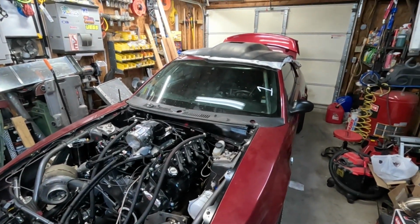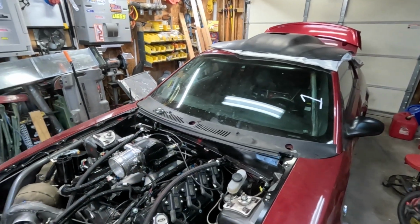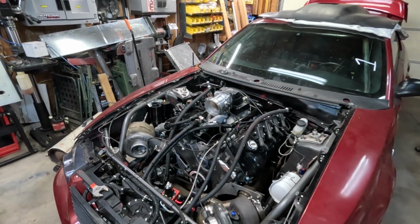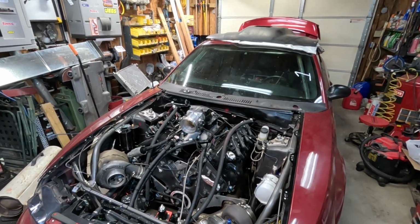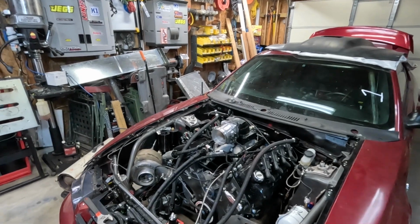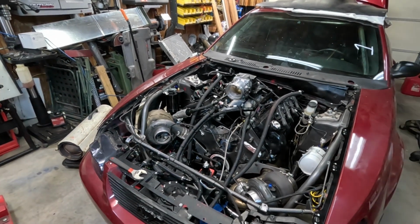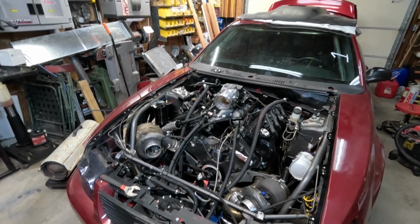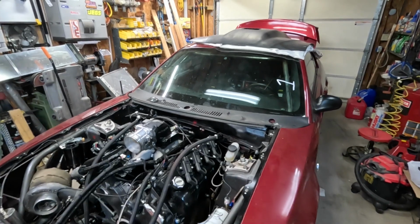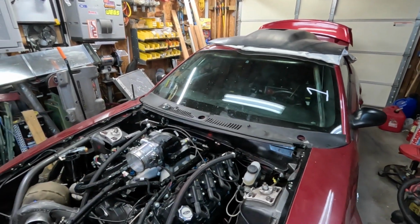Got rid of the Mega Squirt. Went to a Holley Dominator. If you watch back on one of our last track passes a couple years ago, the Mega Squirt hung an injector open and then ended up bending a rod as a result. So that was kind of what put the nail in the coffin for the old motor and for the Mega Squirt deal. So we ended up putting a Holley Dominator in it, and we ran it on a Holley Dominator this year.